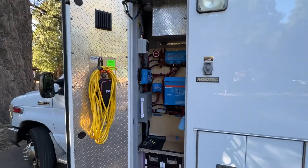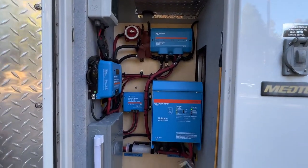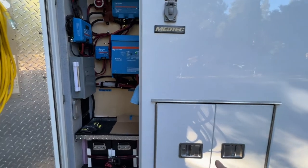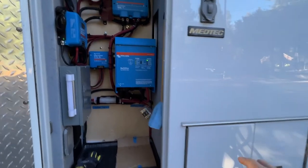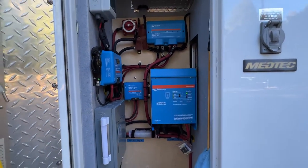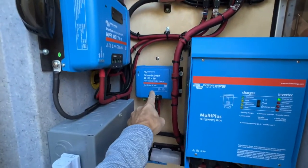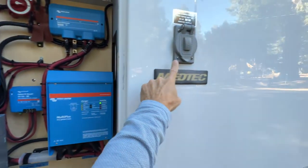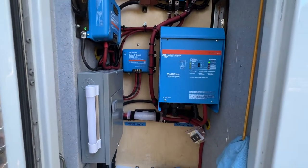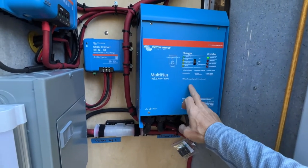So this is the electrical box. If you want to run something, what do you want to run? The existing ambulance had an inverter in here but it was only a 1,000-watt inverter. I wanted something more robust to run more than one thing at a time — and as I mentioned, the induction cooktop uses 1,800 watts, so that wouldn't have run on the original. I have multiple ways to make electricity: solar, I can charge from the alternator, and I can also charge from shore power — plug into a house, a campsite, anything. This is a 3,000-watt inverter at 12 volts. It will accept about 50 amps pass-through — I'm going to make a video to talk about all of that.